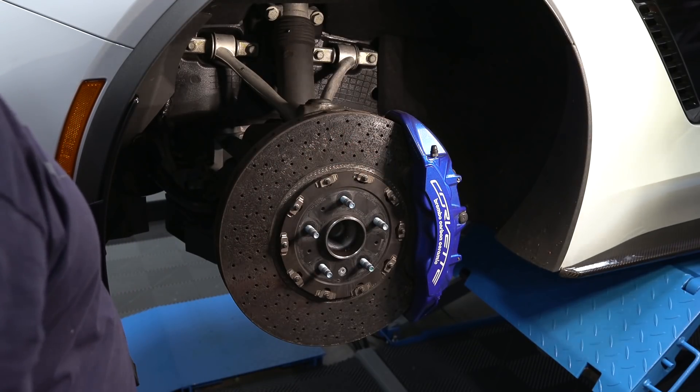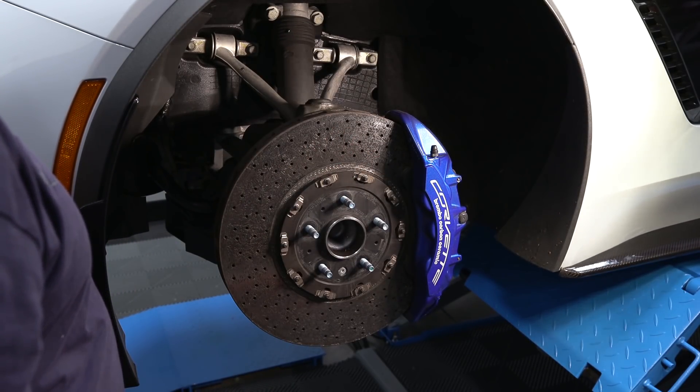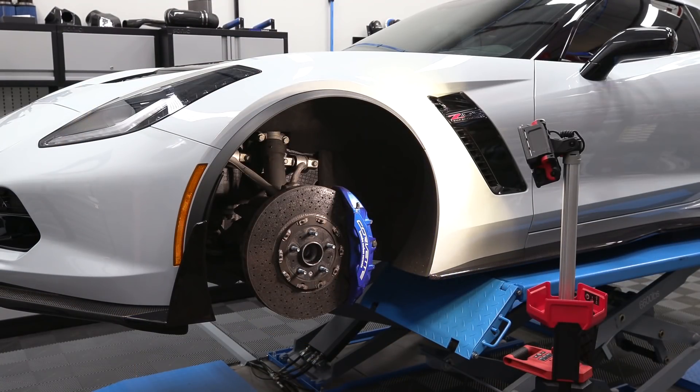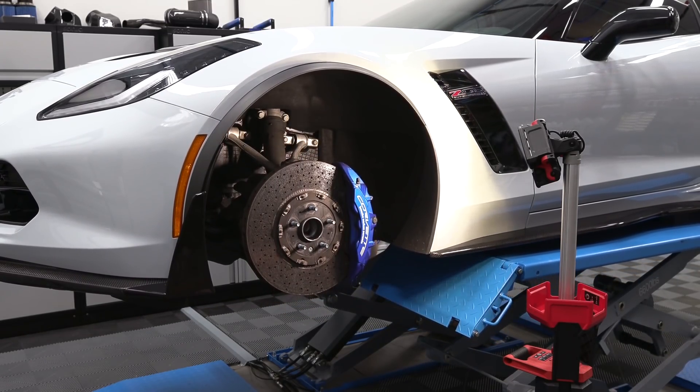This doesn't mean it's bad, but it's not a good sign. Once they're 100 grams lighter, they need to be replaced — that's how you know. Let me go up a little higher on the lift. If you're new here, this is a Twinbush TWS3-19 scissor lift.